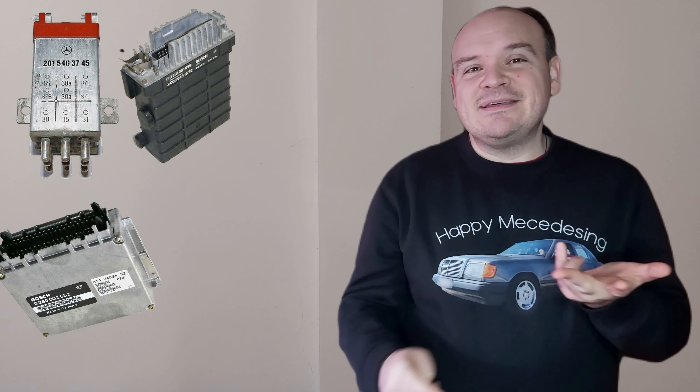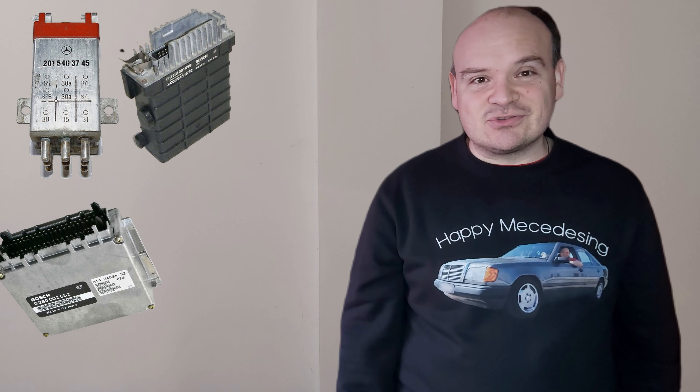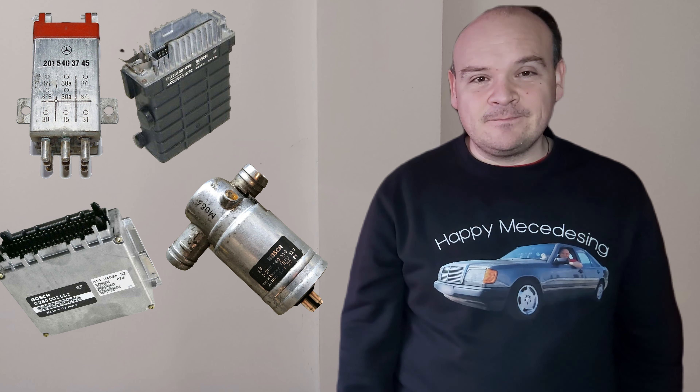So the OVP is working. The ECU is working. And thereby also the idle control valve is working — that is what you have heard. That was 12V. So that means that you get 12V to your ECU, and at 12V it's completely open — I mean the ICV.